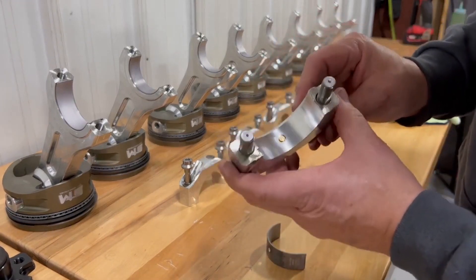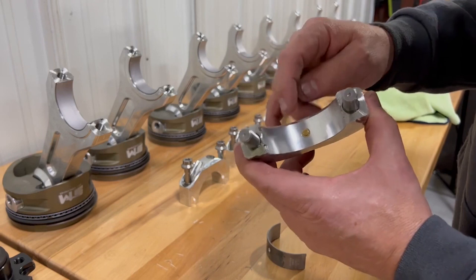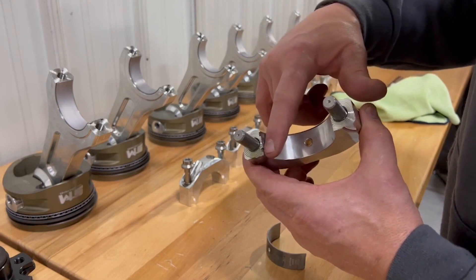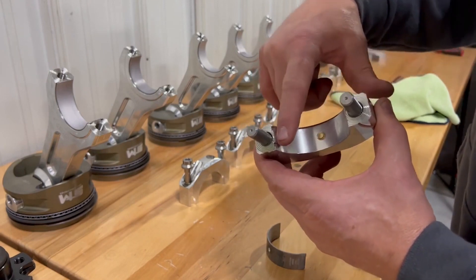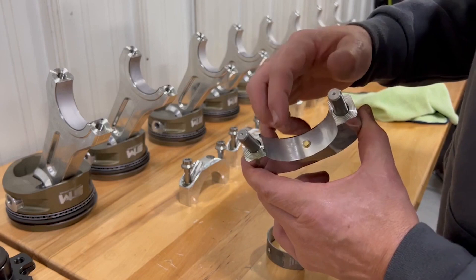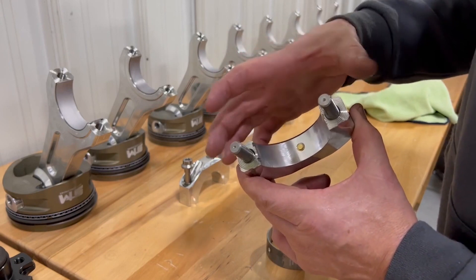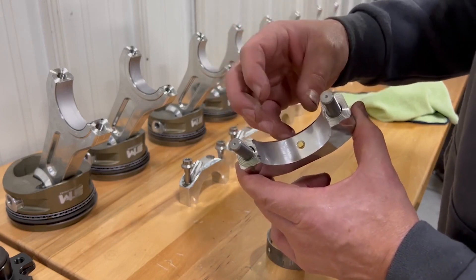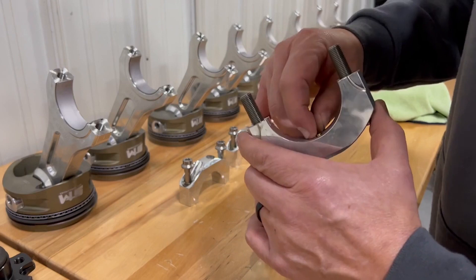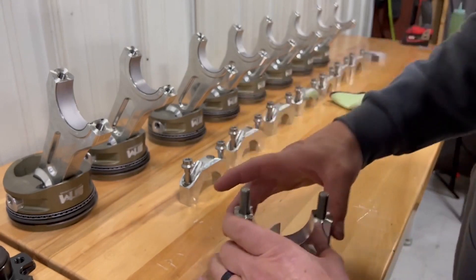In an aluminum rod you have a dowel pin because it helps to locate the bearing. Bearing tangs are not there to keep your bearing from spinning - that's a misconception. They're there to keep the bearing located and not moving side to side. The dowel pin concept is that the housing grows so much that the bearing loses its crush and would try to spin. Probably not a huge concern, but that's the way it's always been done. I'm going to measure it up and see what's going on.